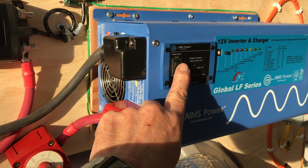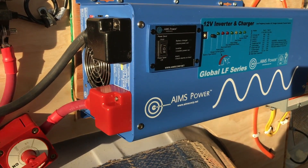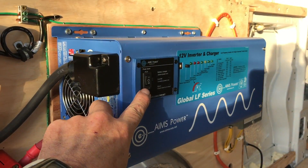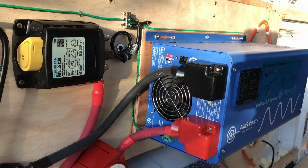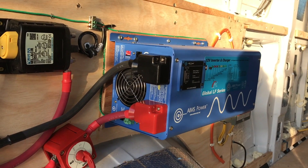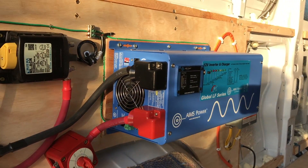It does have a power saver mode, but that's not really useful — I think it takes about 40 watts for it to even activate, and most of the stuff I have doesn't use 40 watts. This inverter does have a remote access option where you can switch it on or off. I did spring for that — it uses a basic Ethernet cable and it's not cheap, about $130. Everything in an RV is expensive; if it says 'RV part' or 'solar part' it's about ten times the price of a house part.